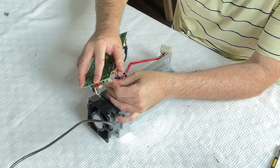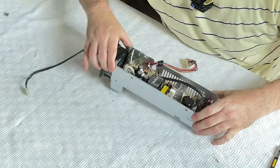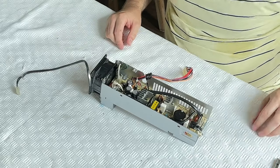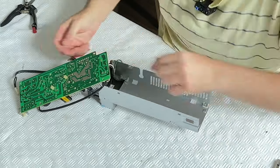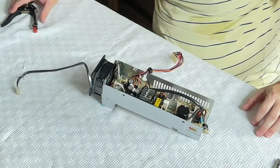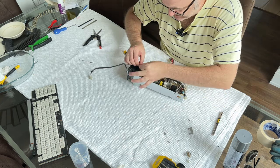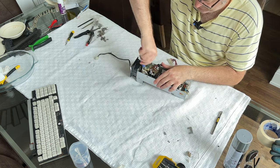And I've just plugged in the cable that goes from the kettle lead to the actual power board itself. And now I've noticed that there seems to be an extra mounting bracket, which seems to be quite strange. And next to it, there's a green wire. So then I realized that this green wire is actually an earth lead and should be screwed to one of those mounting holes. So I've actually unclipped that earth lead that was held in an unusable position with a cable tie. And now I'm trying to find a screw that could be used to put that back into position. I've only got 5 screws, which should hold down the power board. And then the other 2 screws basically hold down the power supply inside the case.